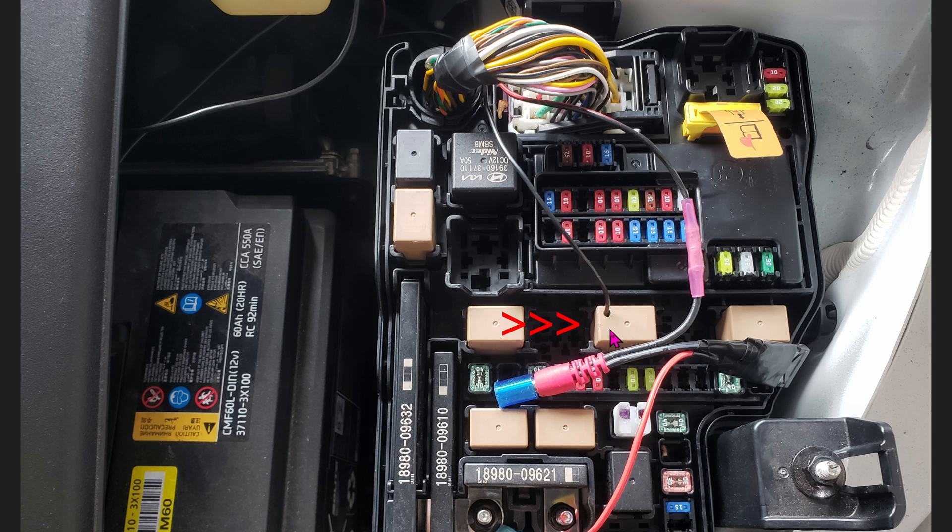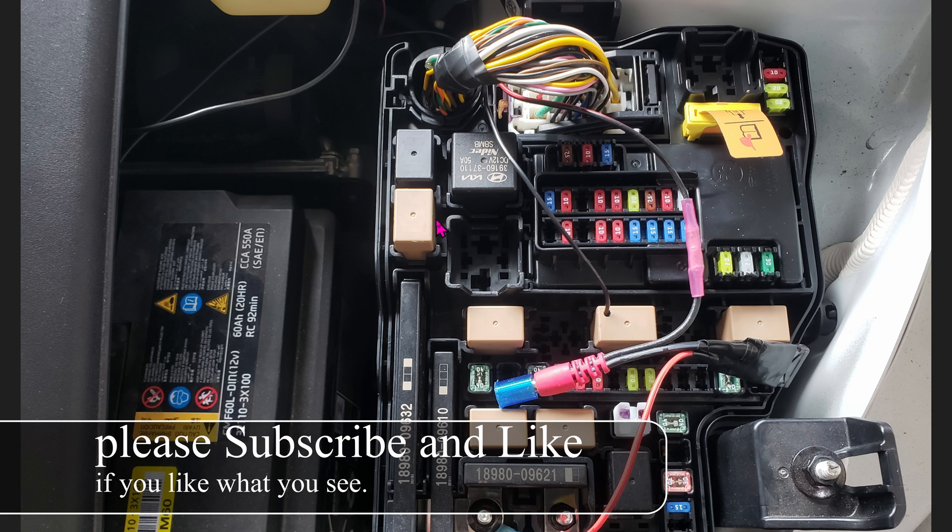The reason being, if this fails for whatever reason, the whole car will stop immediately — there's no way to even turn the steering wheel. There's also a relay for shifting the car out of park, but for whatever reason it does not work without modification to the relay. Today we're going to focus on a Fuse Bypass Kill Switch instead.